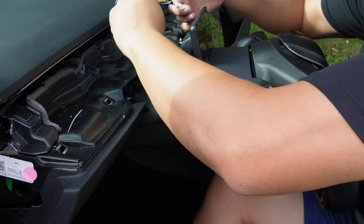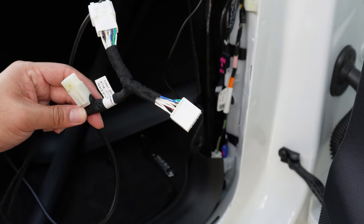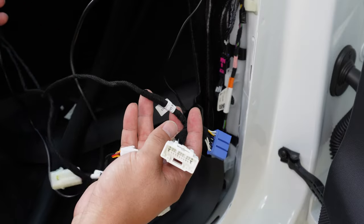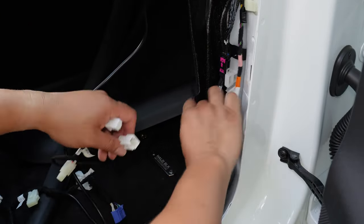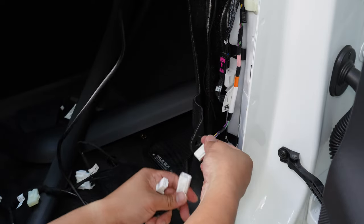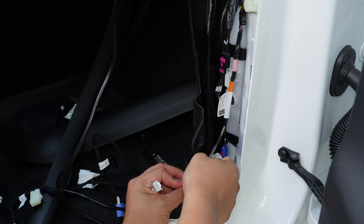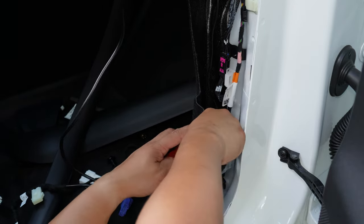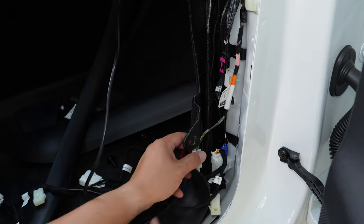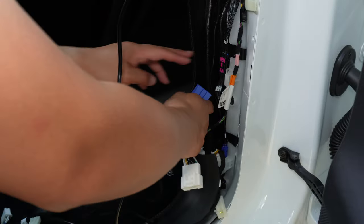As you can see, the cover has the same fit, form, and function with the addition of a screen. The wires come with two connections — one for the Intel and the second for the Ryzen chip. We are to unplug the set of wires and daisy chain it with the wires we got with the screen. Since I have the Ryzen chip, we're going to take the blue clip and install it into the female blue clip that's inside the passenger footwell.